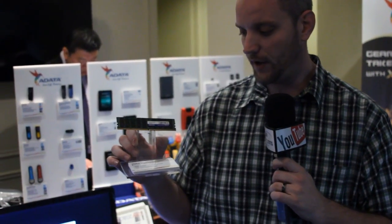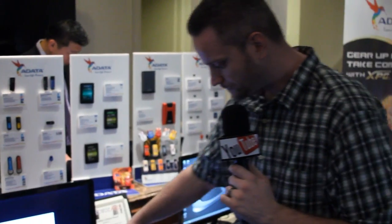We all know DDR4 is not that far away. In fact, I am holding a DDR4 2133 megahertz CL15 RAM module right here. What's the benefit of DDR4? Speed-wise, it may not be an incredible increase, and this is a working DIMM stick but we don't have a demo here to actually show any of its speed. But this is a 16 gigabyte DIMM right here — 16 gigabytes on one stick. It's going to allow you to run 32 gigabytes if you need to on a major rendering station without having to occupy a whole lot of slots inside your motherboard. We do have 8 gigabyte and 16 gigabyte capabilities on these single DIMMs.